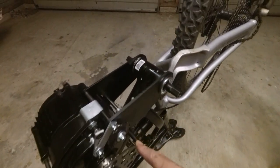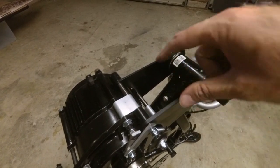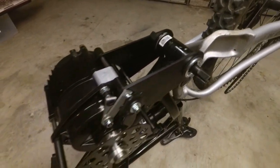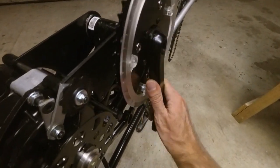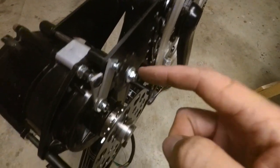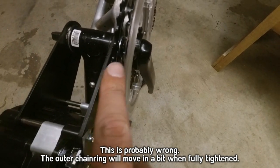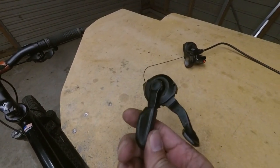I have the motor attached now and ended up with 81mm from the outside of the plates on one side versus 80mm on the other - so there's about a 1mm difference, and it's pinching in slightly, but I don't think that's going to be a problem. I was hoping that because there are two chain wheels here we might be able to move the chain inwards, but it looks like it's made to line up with the inner of these two wheels matching this one - and using the outer wheel would make things even worse. I've also taken the front derailleur and its gear lever off completely.